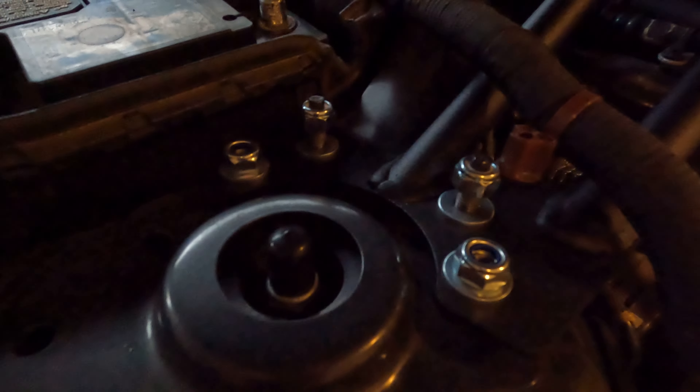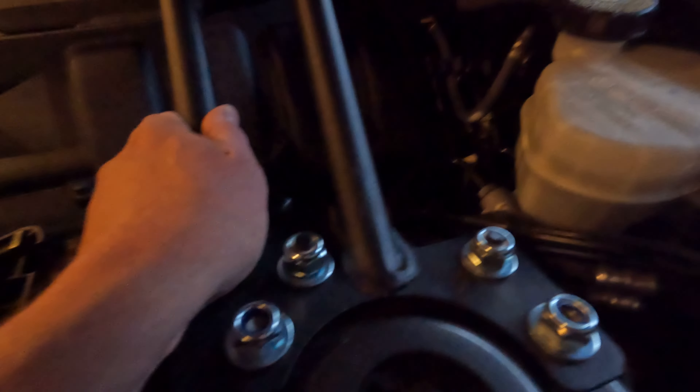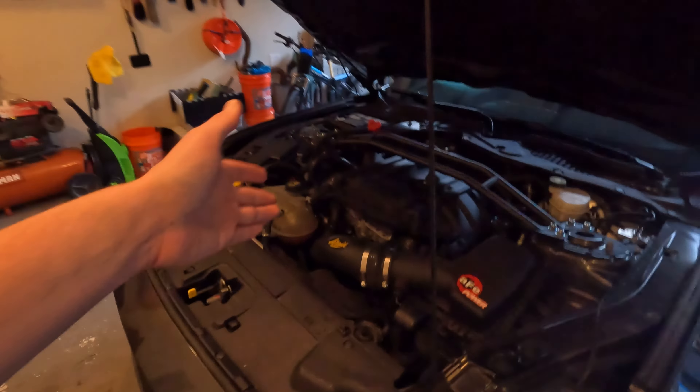They're all mocked up on both sides and there's a little adjustability from side to side, so I'm going to mess with that and then tighten them all down. It's 35 foot-pounds of torque on these nuts. We'll obviously reconnect the battery connector as well. I'm excited — I want to see how much different the handling is up front in the corners, and considering we're on the stock 18-inch wheels, this is going to be a cool mod if it helps out. For about 100 bucks, not a bad deal. If you guys want to buy one new, I'll link it in the video description — that's going to be American Muscle.